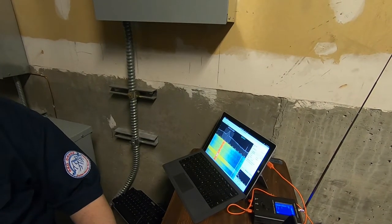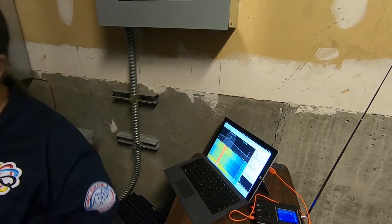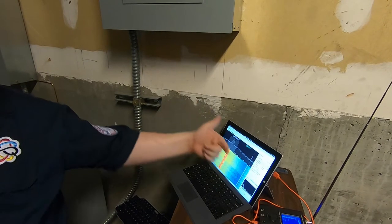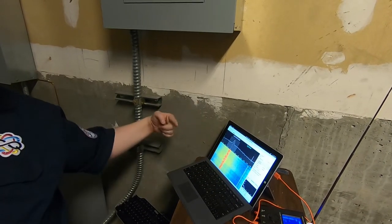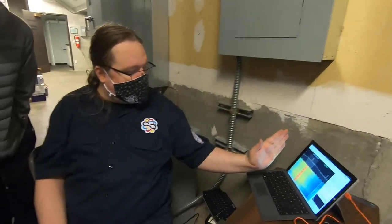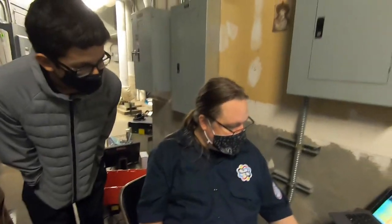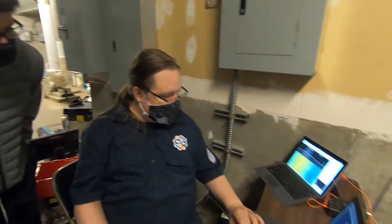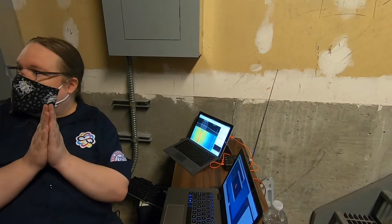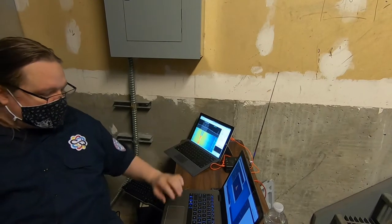And if I stop the transmitter, it's frequency modulated to FM, so the wave wiggles back and forth because the frequency plot is lower frequencies, higher frequencies. So the way it wiggles back and forth is how it modulates the sound. So if I stop it, you'll see the peak, there's no modulation, and the peak is right on 106.5. So we're bang on, we're good.